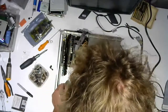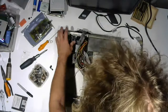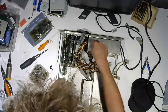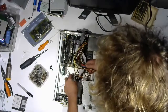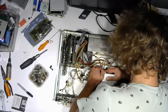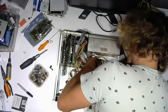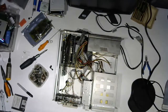All right, so good luck upgrading your RAM. If you're looking at this right now, you can probably see what I'm talking about. The RAM is underneath here, so you have to remove the power supply to pull the RAM out. That's our late 80s, early 90s. Yeah, that's definitely what it is. I have another one of these computers, a 486 I'm building actually, the next one up. The Hungarian 486. I did manage to get it working after a lot of repairs.